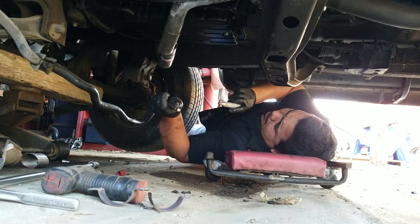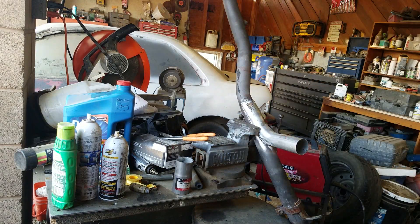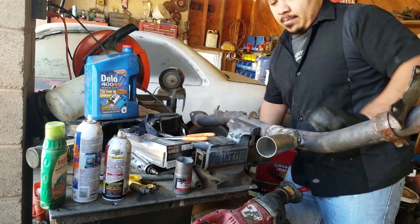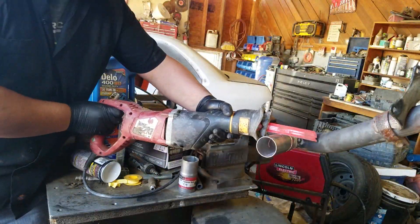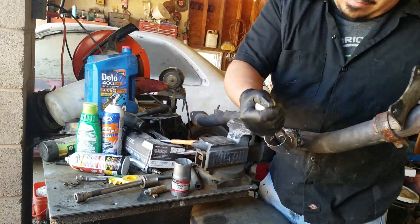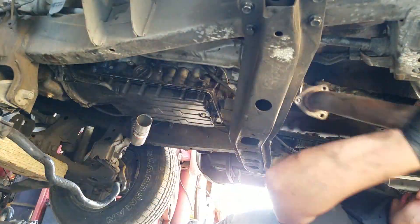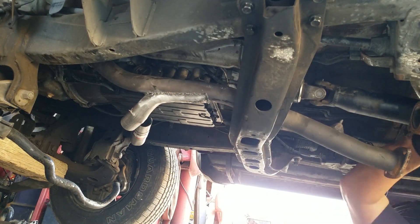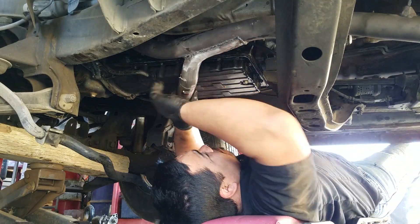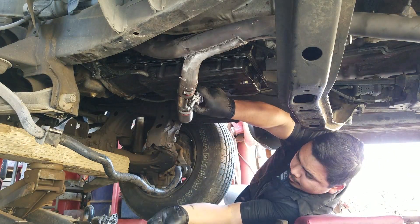What you're seeing right now is me cutting out the pie cut, getting everything aligned and straightened out, then welding it back shut. After it was welded, I put it back on the truck and started bending and twisting to get it straight. I grabbed the exhaust band, put the two ends as close together as I could, tightened it down as if it was permanently installed to get the right bend, then tacked it so it wouldn't move. After that, I pulled the whole thing off, took it back to the table, and finished welding it shut. Just take your time on this — you really want to do this once and not worry about exhaust holes or leaks.